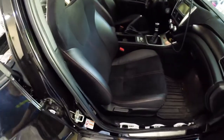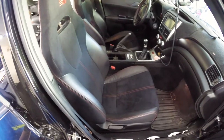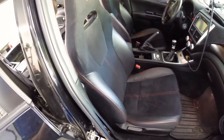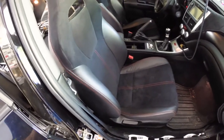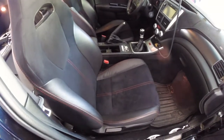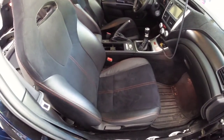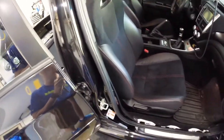I'm about ready to pull the front seat. An important safety tip: you've got to disconnect the battery — that's step one and I haven't done it yet. There are connectors under this seat, and if you undo them with the battery connected, you're going to blow your airbag in the seat, which wouldn't be good. So I'm going to disconnect that battery now, and then I can pull the seat out because all the bolts are out. The back two seat bolts are the shiny ones, at least in my car — that'll help you put it back together.